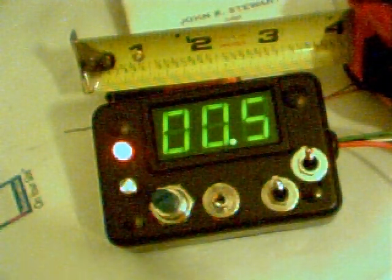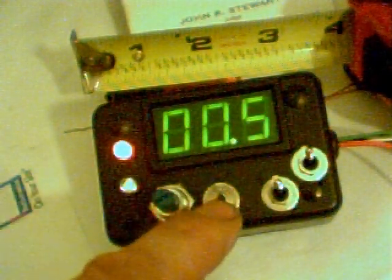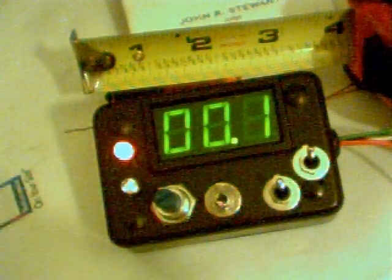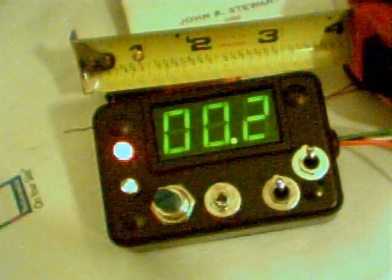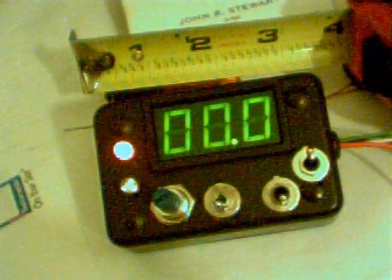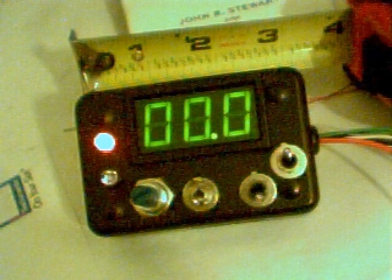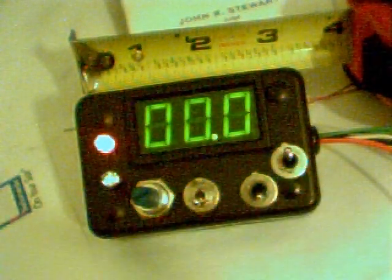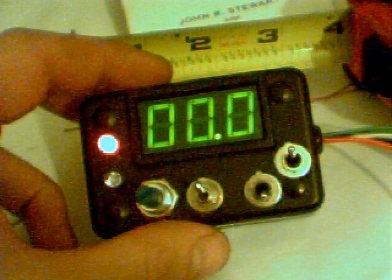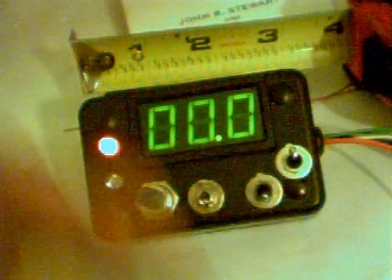At the end of the day you could hit that switch and check if everything's running good, see what the O2 sensors are actually doing if you want to monitor them. With the switch up, it's recording the simulator voltage — even though I have this set up for two O2s, this switch is monitoring what the simulator voltage is doing. This is on a bench so we won't get real O2 readings here, but I'll show more video later hooked up to a car. Switching down hooks the O2 sensors themselves up to the meter so you can see how they're reacting.